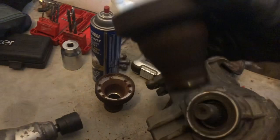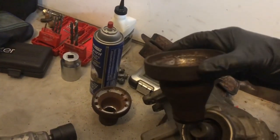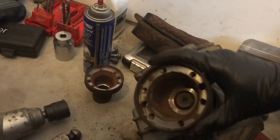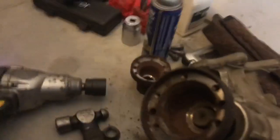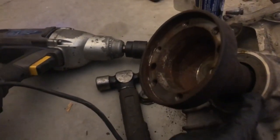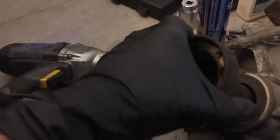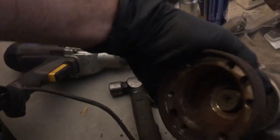So this is the narrower flange from the '02. I had not yet confirmed that you can actually use the same splines, but it looks like you most definitely can. The only issue is you need a different size seal, so I'm going to order that seal which has a narrower inside diameter — I think it's 39 millimeters or something.